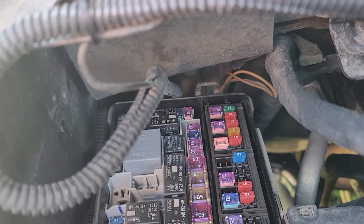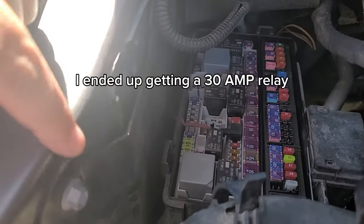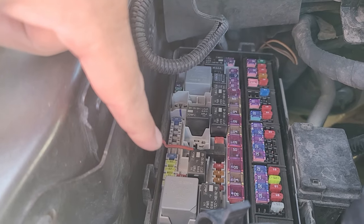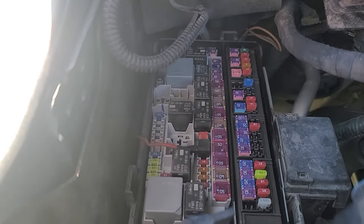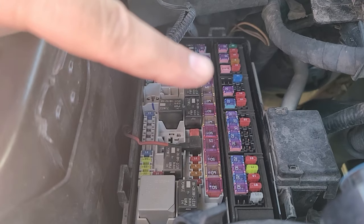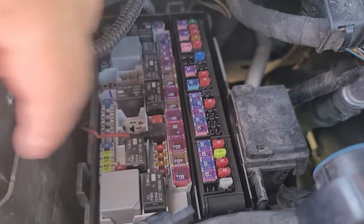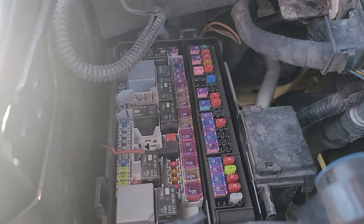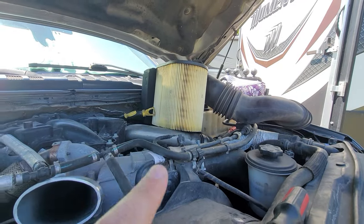What we're going to attempt today is I'm going to buy an external 40-amp relay and wire it up, probably up to here. This is for my Hornblaster's train horn set — I'll tie into this. This is just the remote wire that tells the rig there's power, turn the pump on. I'll get my remote power from here. I have to pull the wire out of the harness, out of that fuse. Then I get power from here and ground it into the frame. If I do that and the pump turns back on, then I know it was a relay. First step is to take this air filter out of the way.